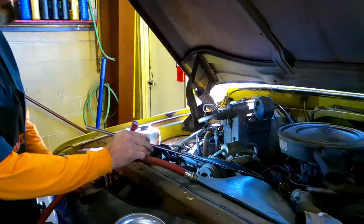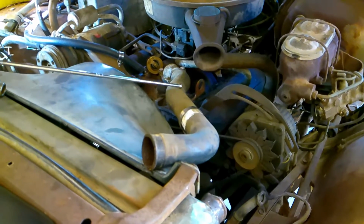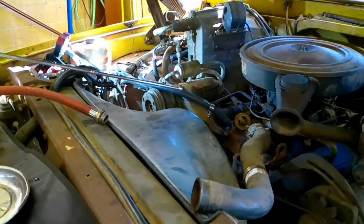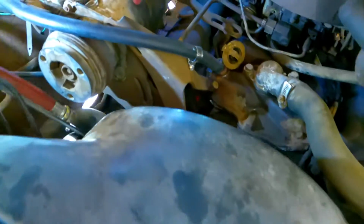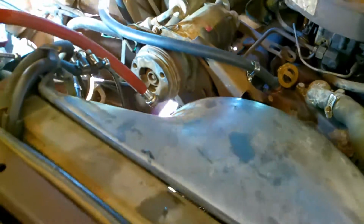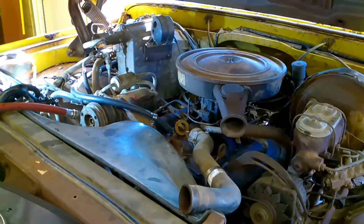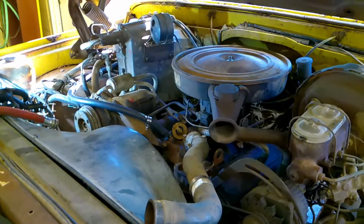First off, you can see that I've removed the thermostat. Now water has a clear channel to go straight through and back flush through the block, starting at the top, going through the heads, through the water jacket, and we'll video out the pump here. You'll see at the water pump down in here, the water will be coming out. It'll be water, not coolant. We have drained the coolant, disconnecting that lower hose, and it has been recycled. Now we have nothing but straight rust in water in this, so we can drain it onto the ground.